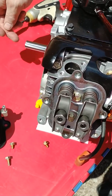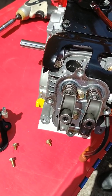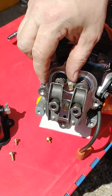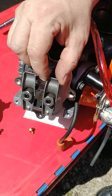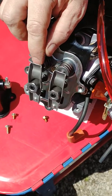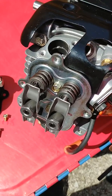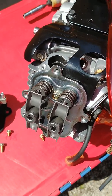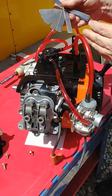If you have your clutch on it, you can paint a little mark right where the keyway is to see it more easily if the engine is still on the cart. So we'll check to make sure — yes, we've got plenty of lash. Lash is nothing more than the distance between the bottom side of this rocker and the top of the valve stem. We measure that with a set of feeler gauges, which you can get at most any good auto parts store.